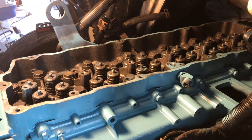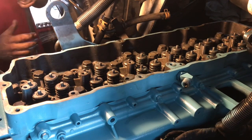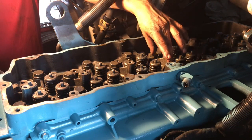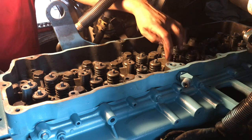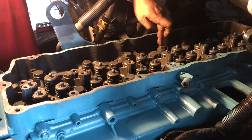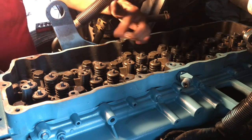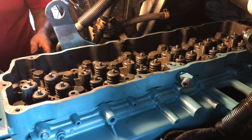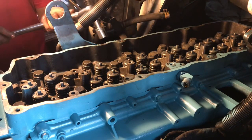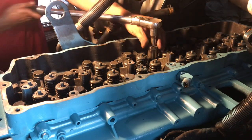We got all the bolts tightened to maybe roughly 15 pounds give or take, so now I'm going to torque them down to 110. I'm going to start with the middle two, then go one, two, and then off to the front — three, four, five, six, seven, eight, nine, ten — so I'm going from the center and going in circles all the way out to the ends at 110 foot-pounds of torque. That is our first torque: 110 pounds, starting center and going in circular motion.